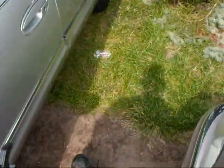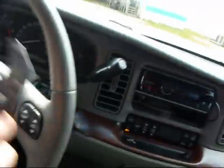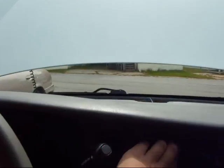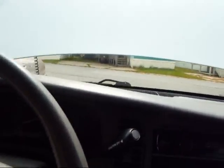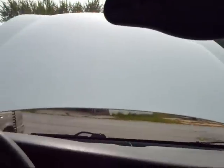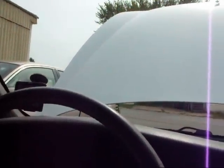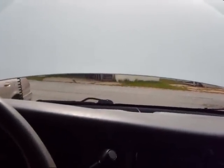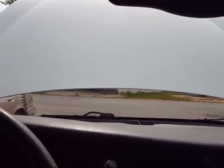Now, as for daytime running lights — at least on my car, I know it's not on every car — but on a Buick Park Avenue and I think a Buick LeSabre, all the daytime running lights are is the high beams at half power. That way they shine yellow and really dim, basically like the yellow of my mom's Buick Century when it's driving down the road. The reason you can't use HIDs for your daytime running lights is HIDs do not work at half power.